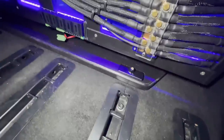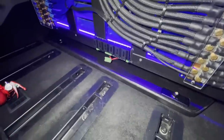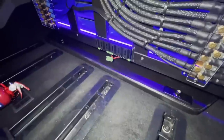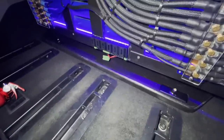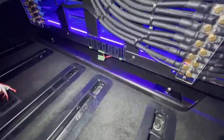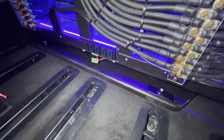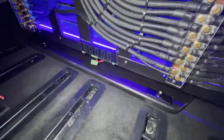I removed all of the foam in the areas where these seats are, so just behind these, effectively between these points, inside the box, under the floor there was foam. Yep. So I pulled that out and I put in birch ply, doubled it up and planed it till it was the right thickness, and then laid that in underneath the floor. So giving you the support. Yep. So I can then clamp against it, because otherwise I was just hugging the carpet down. Yeah. Well, sometimes this is good for isolation, if anything. Absolutely, yeah.